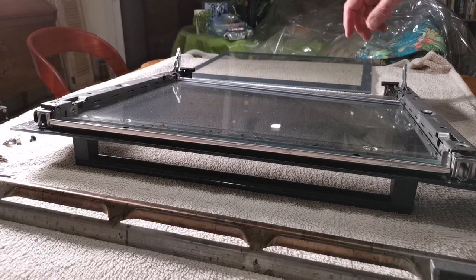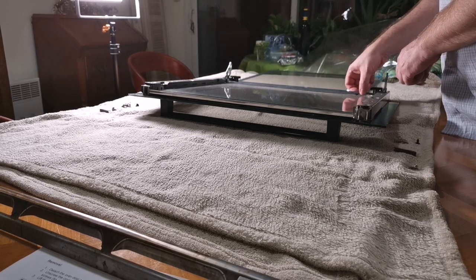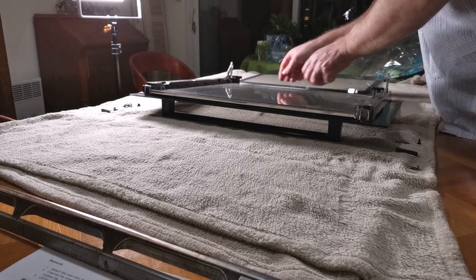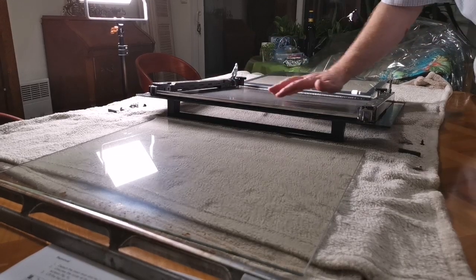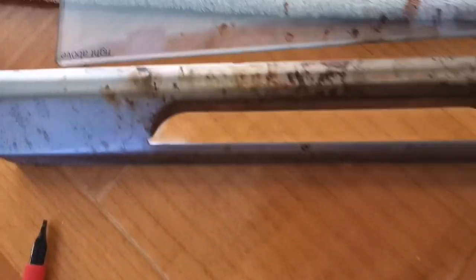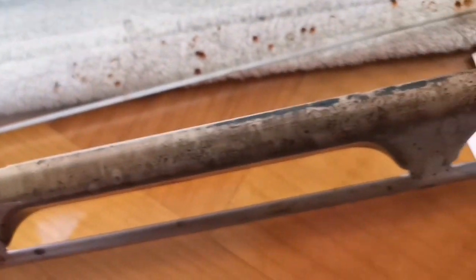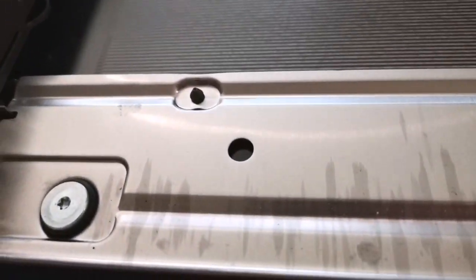This is the seal which also has broken glass on it. So now we can clean all this before we fit the new piece and put it back together. We lift this piece out — this is the lower heat seal — and take that off carefully. It gives us an opportunity to clean this; there's bits of broken glass, bits of dog hair and various detritus. This would be a good time to clean the metal — it's stainless steel, so anything that works well with stainless steel would do here. The glass could do with a wipe as well — nothing abrasive — and that could do with a wipe down inside too, just a soft damp cloth.